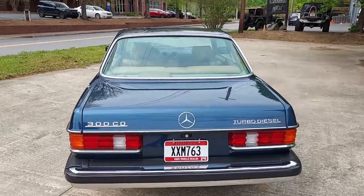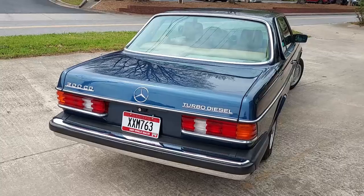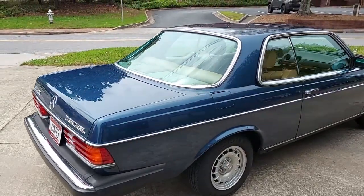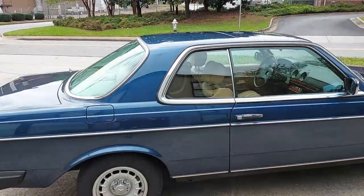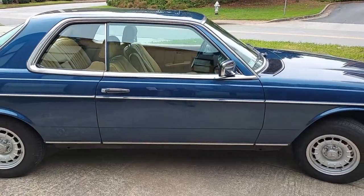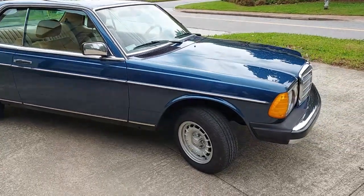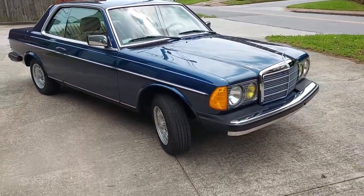New washer pump grommet, new vacuum modulator, new glow plug relay, resealed turbo drain tube, new crankshaft sensor, new upper control arms, old stock replacement hood hinge. One of the hood hinges had a slight bend in it. Replaced dash with old stock original dash. Refinished all of the wood, sent it off to Madeira Concepts. Rebuilt the climate control vacuum pods. New bulbs in the gauge cluster. New dimmer switch. Removed and serviced rear window regulators.